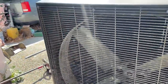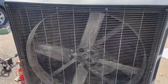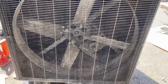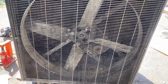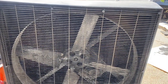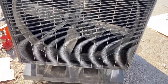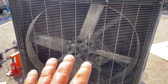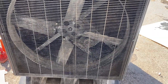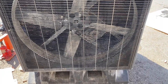It really does move the air and helps a lot, but this week it's been in the hundred and teens every day, so I'd like to get a little more out of it. You can spray the back of it with a hose and get about half an hour, 45 minutes worth. Now I know some of you are saying you can't run an evaporative cooler in a machine shop — it'll rust everything. But it's case by case. I live in southeast Washington, and for those unfamiliar, the whole state is not a lush green forested area. I live in a wasteland — it's technically a desert, very very dry. The little bit of moisture this puts into the shop, with a fan this small, won't affect anything. I keep my machines well oiled, so I'm not worried one bit. It's not going to cause any rusting issues.